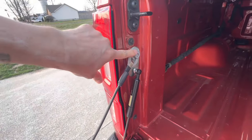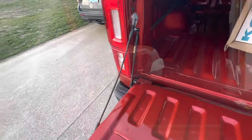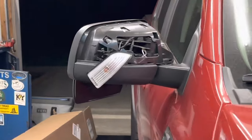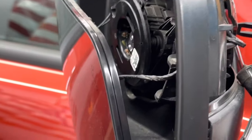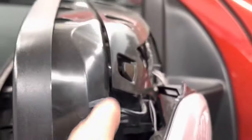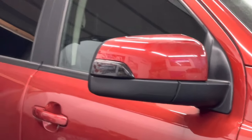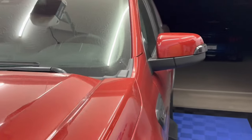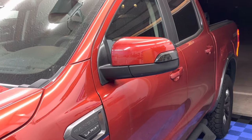You'll need a T50 for the main bolt, and a 6mm Allen wrench for the two bracket bolts — no issues at all, looks really good. Next up are the clear turn signals. I got the passenger side off — all you have to do is pop this mirror piece off, it just pulls straight away. Then there are some Torx screws — took four of them off, popped off the lens, and now we're replacing it with the darker ones. There it is — looks way better. Those white turn signals just looked gaudy, so that's what it looks like when it's flashing.